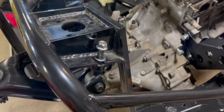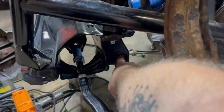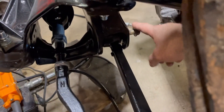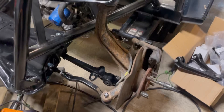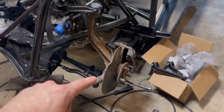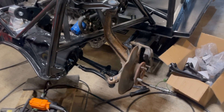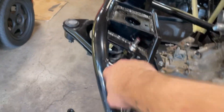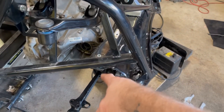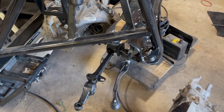The company didn't put enough spacer there — not sure why, but that's what happened. I kind of slammed this on just for the moment; I did grind it out to get it to go in there, which was a pain. I just wanted to see if it was going to line up. I went to the hardware store and got more washers so I could tighten everything up. Both lower control arms are now on. It required a decent amount of grinding, which is unfortunate — maybe I'll replace it with energy bushings in the future. But it's really starting to come together.